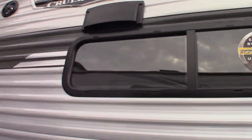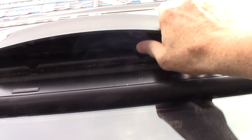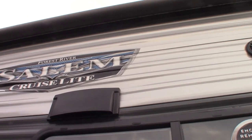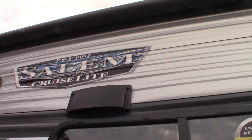Outside speakers. Keep in mind that this is the vent for the range hood that's over the stove. There's a baffle in here — you can snap it shut, or you can leave it open to flap freely. You want it flapping freely when you're venting to the outside, otherwise it won't vent. Always make sure that's open if you're venting.